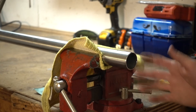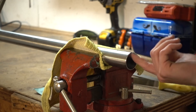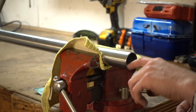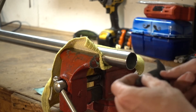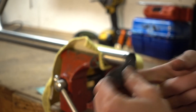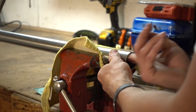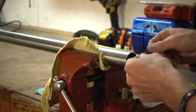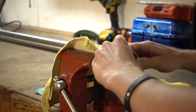At this point you're practically done, but I always like to do one last finish check. Run your finger all around, make sure you don't feel any sharp burrs — anything that's going to keep your fork from sliding on perfectly. I also like to grab a little scrap piece of grip tape or sandpaper and file around. The grip tape is sticky on the back so I can stick my finger to it and it acts as its own little file. Run your fingers up through there to get rid of any last micro burr.